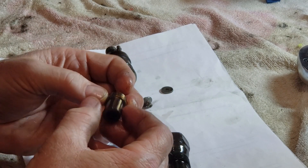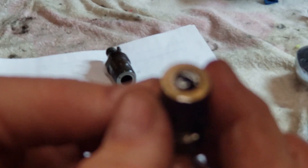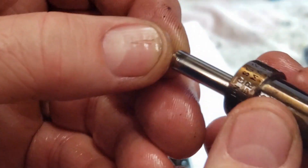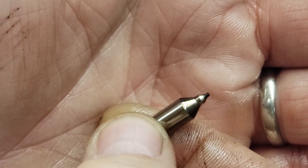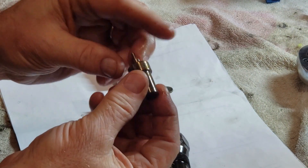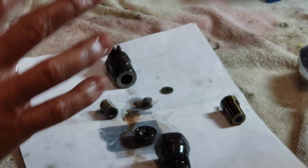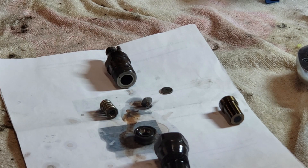The nozzle is kind of brownish and nasty — I'm guessing these are the original nozzles from 1984. It's an SD-240, made in Germany. I think they call this the pintle — it's got a very tiny little nib or tip, and there's actually a little hole that goes horizontally through it, but it's too small to see on camera. This is what we're replacing. Right now I'm going to use some brake cleaner to get these little parts cleaned up before I install the new nozzle — I'll do that off camera, then we'll reassemble.